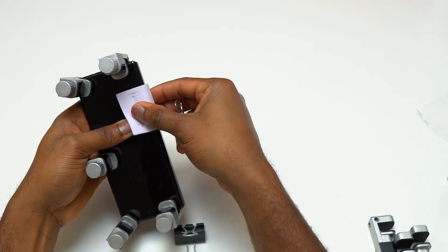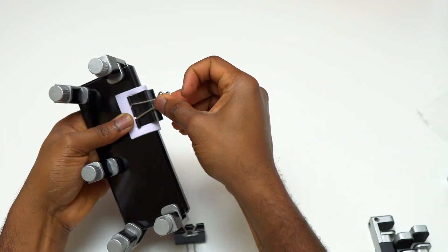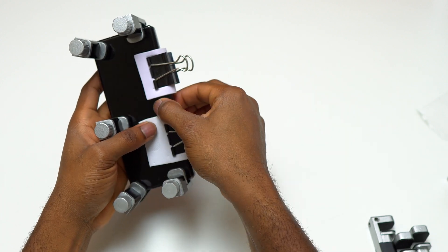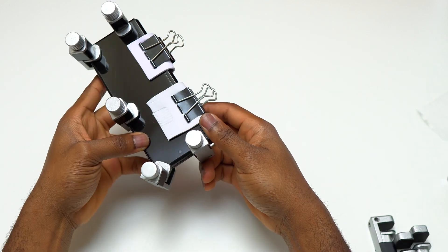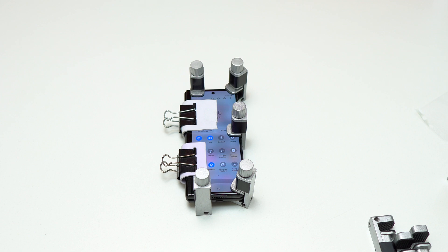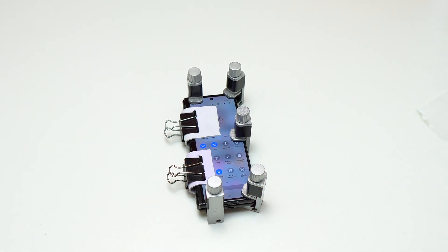After the installation of the screen, since this is a liquid glue, you need to have the screen in place with a little bit of pressure applied on it. For applying pressure, I'm using repair clamps. The clamps were too small for the hinge mechanism area, which is why I'm also using paper binding clamps in that area. After 10 to 20 minutes you can remove all the clamps and start using the device, but you need 24 hours for the glue to be solidly cured. Share, like, and subscribe — see you next time.